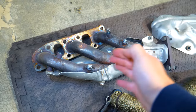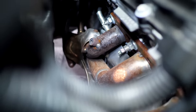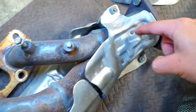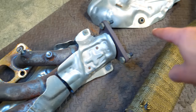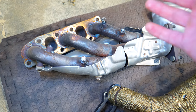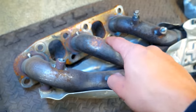Let me show you what the exhausts are. So this here is one of the OEM manifolds off the car. This is what makes every Z and G sound like a trumpet. The small primaries, the unequal and turbulent runner lengths, and the collector found right at the header are all things that contribute to a restrictive design. These headers may be designed to produce more low end torque than equal length long tubes, but as soon as you get past 2000 RPMs, they're going to be inferior.